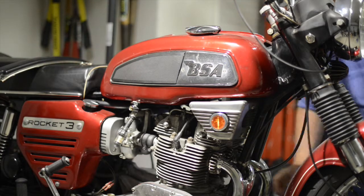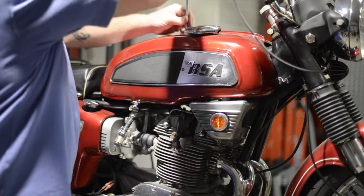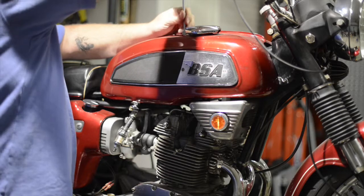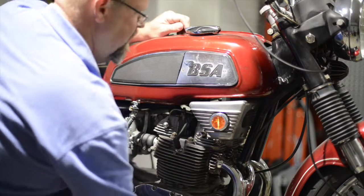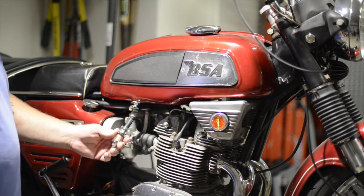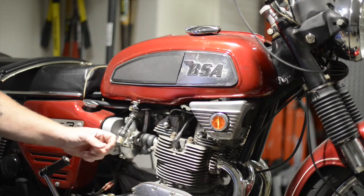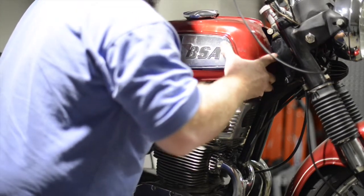The center bolt is a half inch — that's the only thing that holds the tank on. It goes into a notch in the frame and clamps it down. I've already drained the gasoline, though there's a little bit of gas left right along here where I'll have to invert the tank and clean it out. I put inline glass filters on here from a motorcycle superstore so I can see if there's any debris coming through. There are also a couple of rubber mounts around the frame.